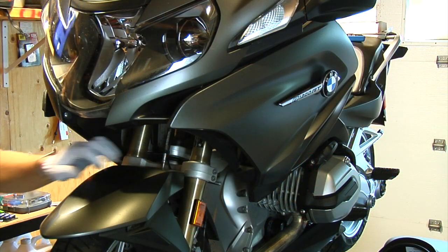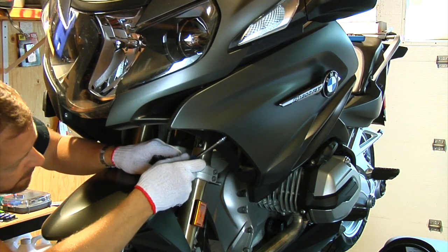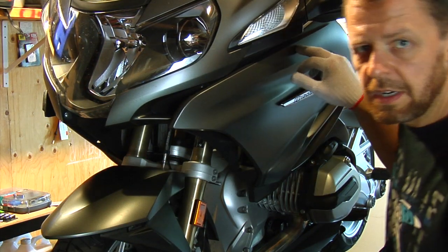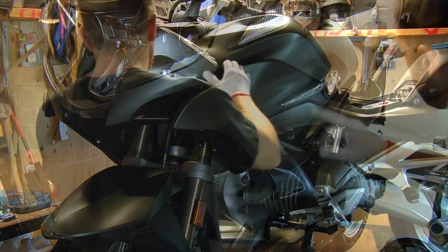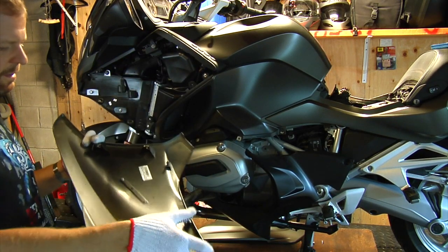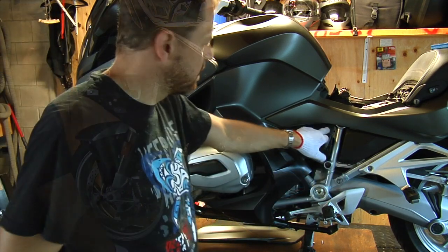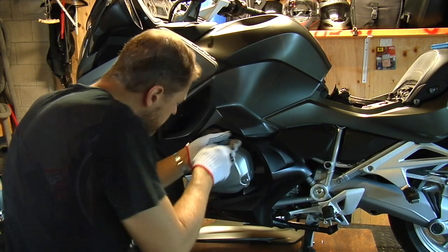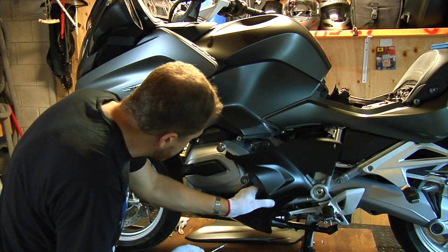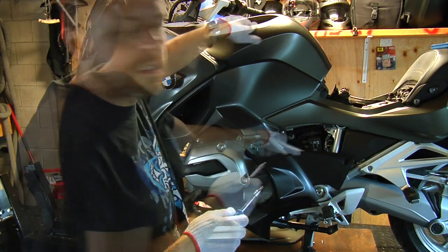On the front of the bike you have to remove two screws that are right in here. There are some screws hidden inside. The fairing comes off — there are a couple of clips here. It simply comes off once you remove these two screws here. There's a screw here, one here, and also one where the oil filter is — I'm not going to remove that one. I just need to access the air box. There's one here.